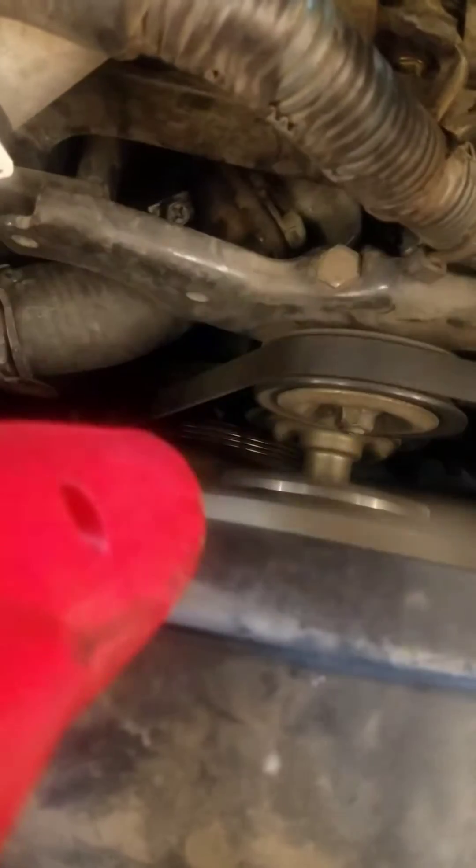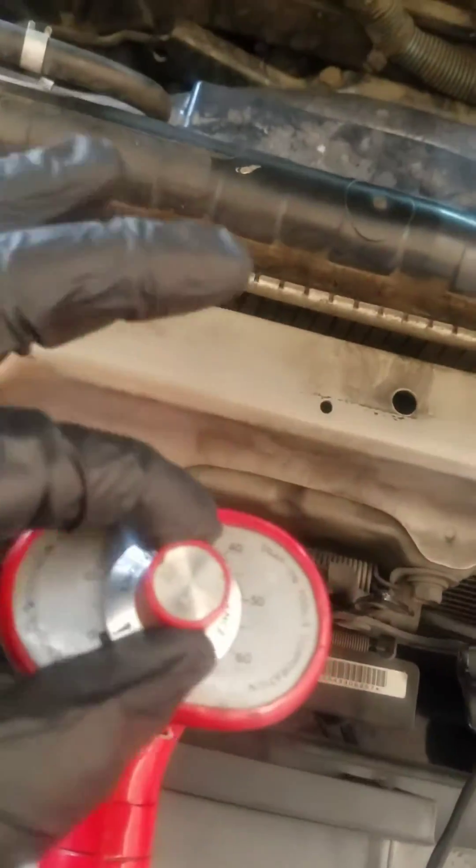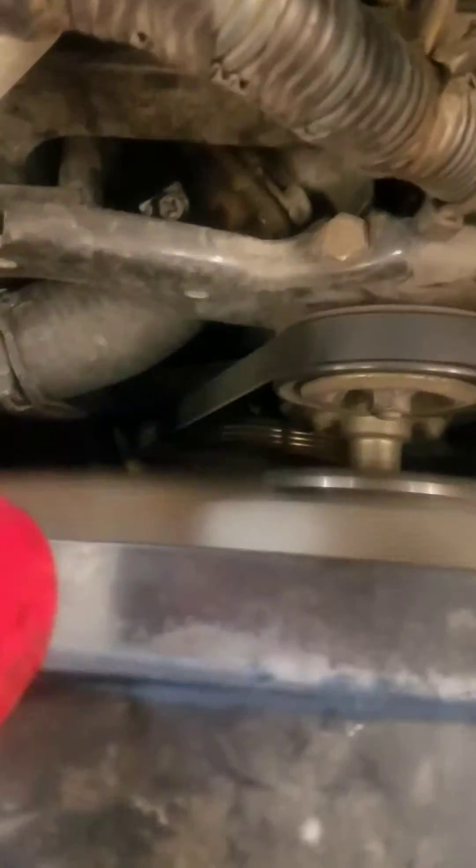which is a little bit hard to see, but if you manage to put it right in the middle of the five lines, that shows us we're at 10 degrees. To double check on that, we put 10 degrees on the timing light, and then we check again and we should have our timing mark on the last notch.